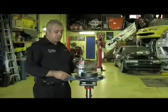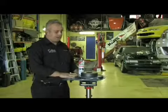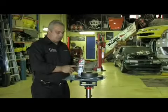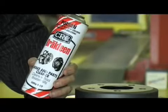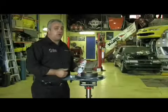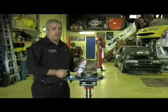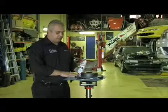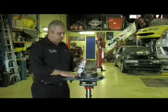To prepare the disc for service, we need to clean the friction face. It's very important that we use the right cleaner. Today, we're going to use a brake clean — it needs to be an acetone-based cleaner. Don't use any petroleum-based cleaners or carburetor cleaner, because carburetor cleaner is a silicone base and can leave residues on the disc face, which will contaminate the pad and give poor braking performance.